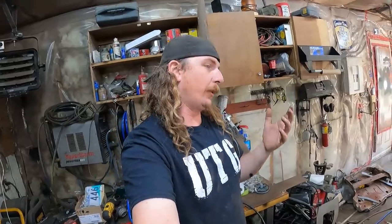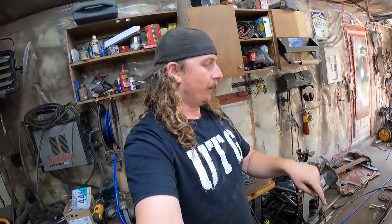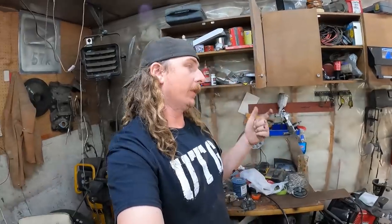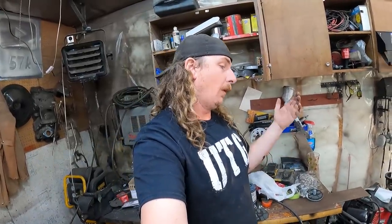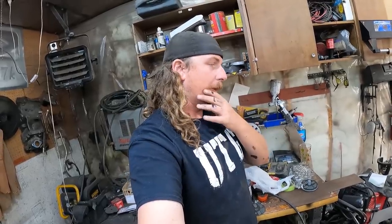Now underneath, once we get it back in, I'll show you. The passenger side spring has been ripped off, and the frame is twisted where the hanger is, unfortunately. So it's kind of mangled up. The driver's side's still okay, so I'm thinking we might pillage that spring and put it on that other frame. I did get new bushings and all that for the leafs anyways. Or order new leafs next week, but I kind of like to stay a little cheap. It's already getting a little bit out of budget.